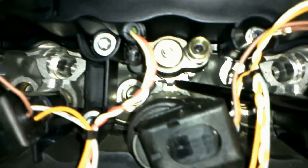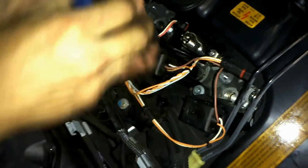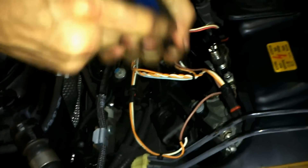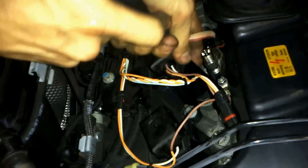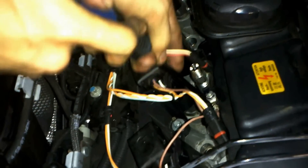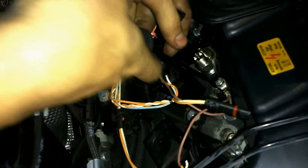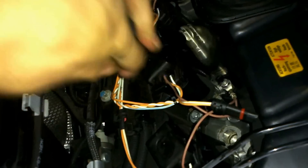A little trick I've gotten onto with these injectors is to get a big pick and get it round underneath this little arm, just there. You can get a big pick in underneath that and pull it up just enough. Give it a tiny bit of side to side, back and front, and give it some pressure up, and you should find after a little bit you'll have these injectors out without the use of a special tool. There we go — one injector.